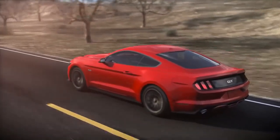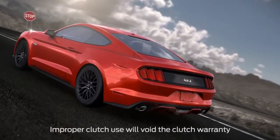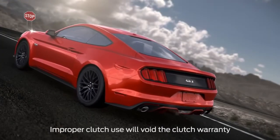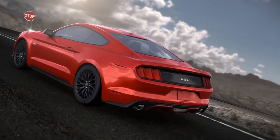Here's another thing you should know. Don't drive with your foot resting on the clutch pedal, or use it to hold your vehicle at a standstill while waiting on a hill. Doing so may overheat the clutch and prematurely wear it out. This could nullify a clutch warranty claim.